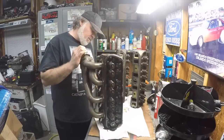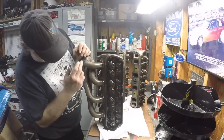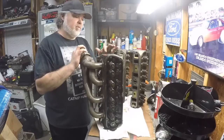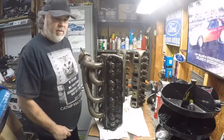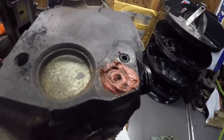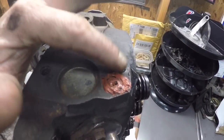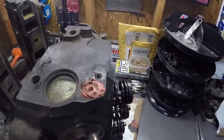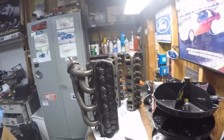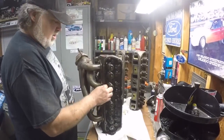Okay, we got one of the heads off — we pulled it off as one assembly, all the plugs in, all the header bolts still on. Someone asked about plugging the ports in the back — that right there is just a plug with some red RTV on it. You can actually just use the old bolt to plug off the back side where the EGR tube was.